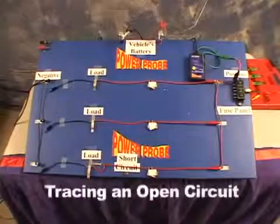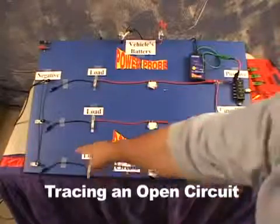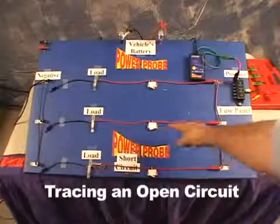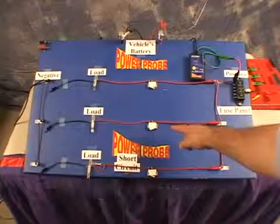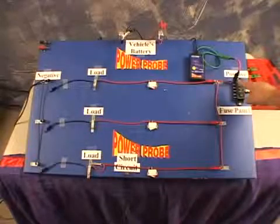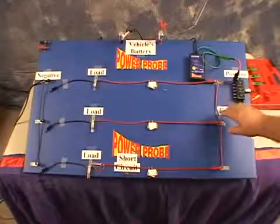Let's look at this new circuit scenario. We disconnected all grounds at the end of our circuit. The middle switch is open to represent a break in the circuit that we need to find. We're injecting the open circuit signal into the main circuit that feeds all these open branches.